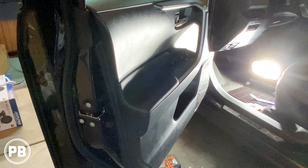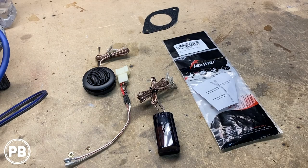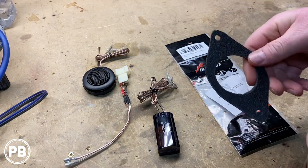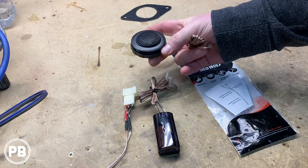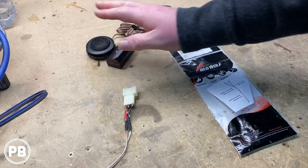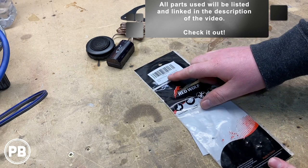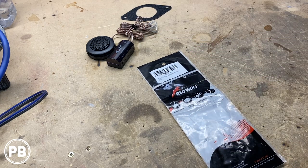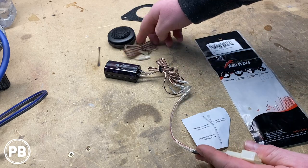The door speaker is all good to go. All we need to do now is head up to the dash area and start working on the tweeter. For the tweeter, we've created a bracket out of ABS plastic — you can also search on Amazon for a similar shape bracket, and we'll post a link in the description. We also have the tweeter that came with our component set, along with the crossover that goes specifically with that tweeter. To make sure it plugs directly into the factory harness, we picked up the Red Wolf wiring harness adapter, part number X0025S4U43 — we'll put the info in the description. This will plug into the tweeter harness and wire up to our tweeter, then we'll hook the speaker to the crossover.